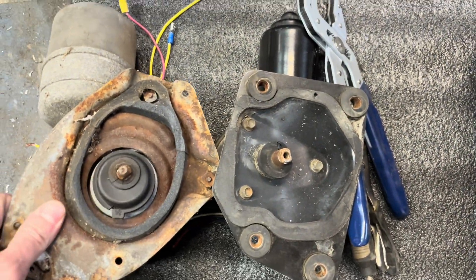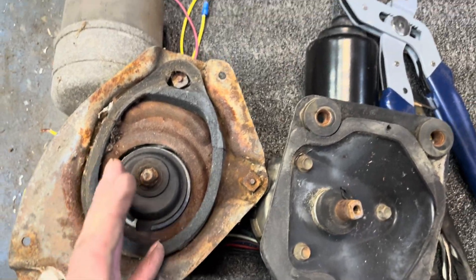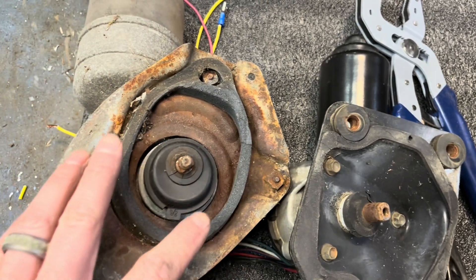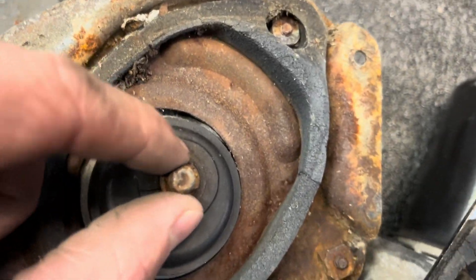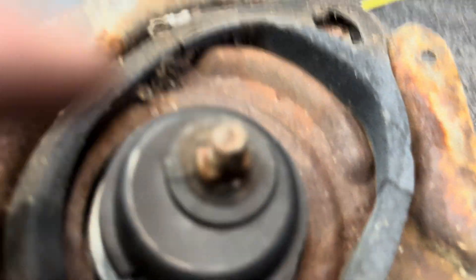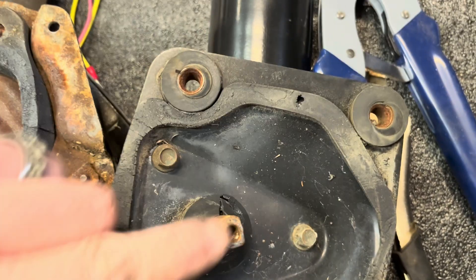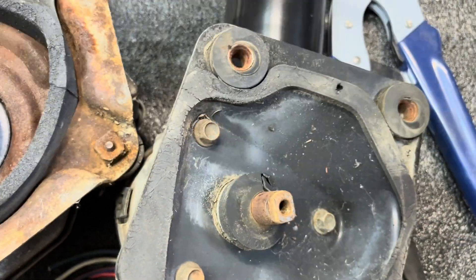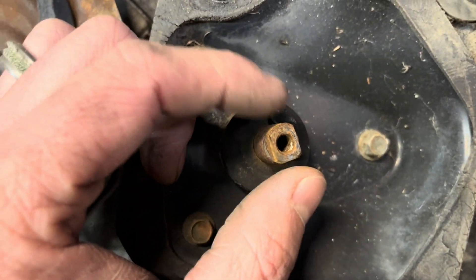Here's the comparison: the Chevelle OEM wiper motor versus the Ford mini wiper motor. You can see how much of a difference there is in size. The Ford is a lot stronger than this older style GM. The way the motors are made, it can put a lot more torque out to the rod. Looking at it right here, you have your round rod and your slant with grooves on each side — your Ford is exactly the same way, just turned. This one uses a screw to go directly in to hold it versus the Chevrolet which uses a nut. These two are pretty much nearly exactly right.